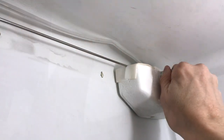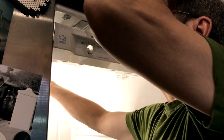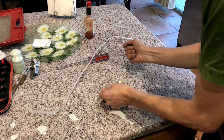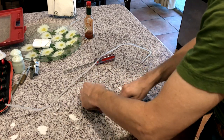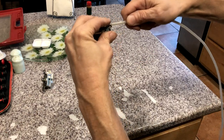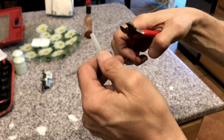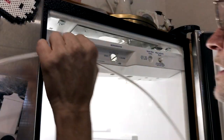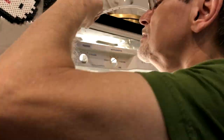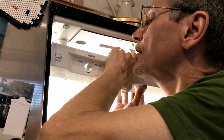Okay, this looks good. Now having uncurled the tube that goes with the thermostat, I'm pulling it out and this is looking real good. I'm going to need to take this off and put it on the new one, getting it as close as I can to a straight line, and then put the plastic tubing on it, being careful not to crimp or bend it. It's about three-quarters of an inch. Be very careful when you cut this off not to cut into the metal tube. Now I'm ready to thread this back through the same way I took it out, and it went underneath that metal rod.